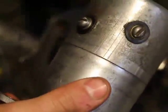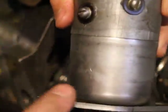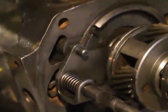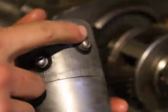Now the number 6, let's suppose I didn't know which one was which. One of them is connected to a contact point on top. Therefore, if you try to put electricity through here, remember this is connected to the metal here, to the transmission, which is connected to the engine, which is connected to the ground of the car, which in most cases is the negative. For 12-volt cars, it's negative. So first thing you should do, you should connect your negative terminal. I like to use a battery charger to test these things. Connect the negative terminal here to any point on the case, and then one of these terminals will be the positive.